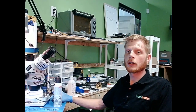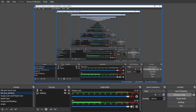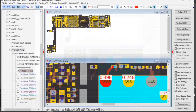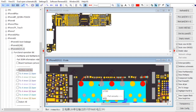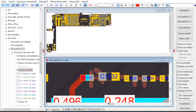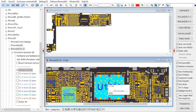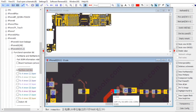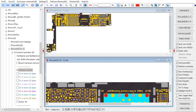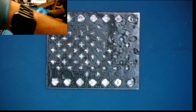So the next step here is to go ahead and look at ZXW and see what my shaky hands just knocked off the board. Just so you guys can see, it's going to be a capacitor here for PP3V0_NAND. I'm not even going to replace that because PP3V0_NAND has several caps on it — it is not going to miss that tiny one. Okay, so the next step is I'm going to reball the NAND to get it ready to go in the programmer, and I'm going to add flux to it.